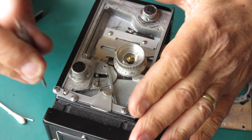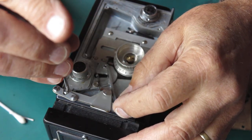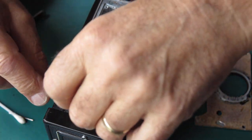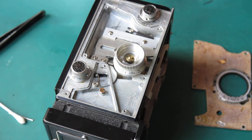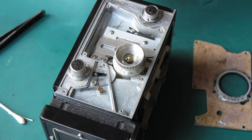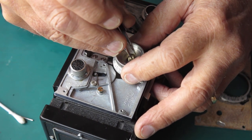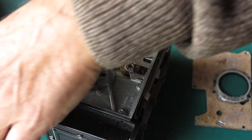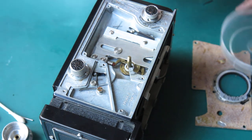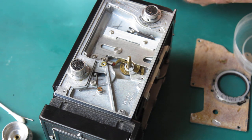I've lifted the back off the camera — I want this bracket off. I need this knob off here, so I'll undo that nut. Lift that knob off — that's our focus knob. Now I've got two shim washers; one went there and the other one went here.